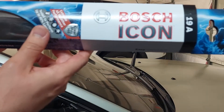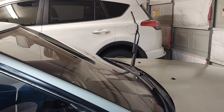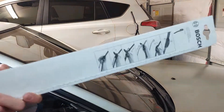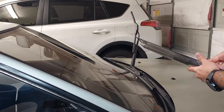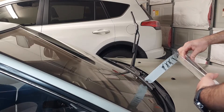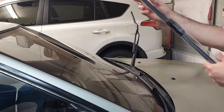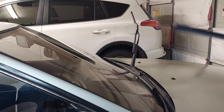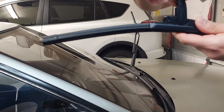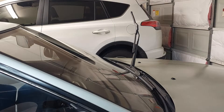Your mileage may vary, but I'm using these Bosch Icon blades. They're very similar to the ones I had on there, and they got pretty good reviews. They seem pretty robust — the packaging is pretty good, it's kind of overkill packaging. Once you pull it out of the paper, it's got this sleeve that holds the blades in form. Just going to slide that out. Again, it's got these little pieces that you press together to pull up, and then that pole on the arm hooks in on this side, so I'll use this screwdriver.